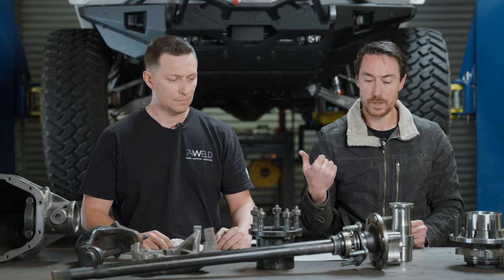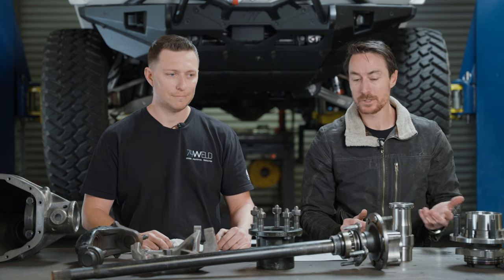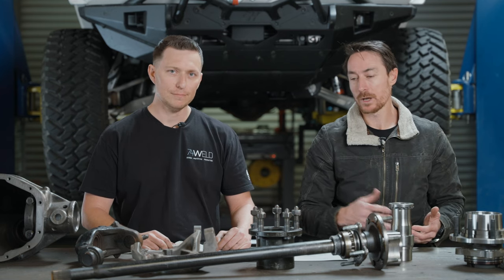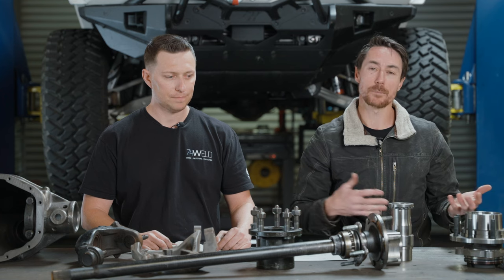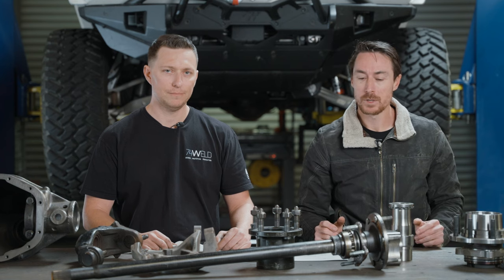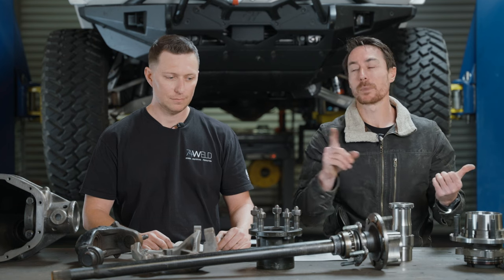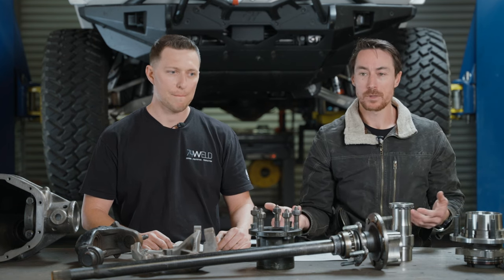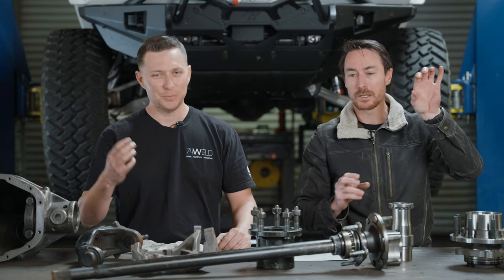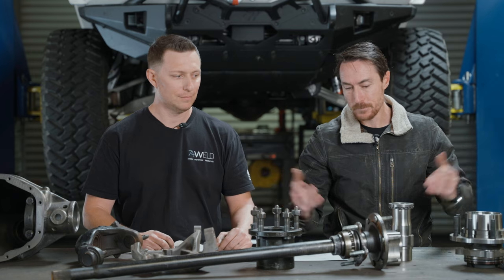On the rear, on the upper gear, every one of our upper gears is also 35 spline — that allows you to run a Dana 60 if you decide to upgrade housings, since standard shaft diameter on a Dana 60 is inch-and-a-half 35 spline. On our current kits with factory housings, you're going to get a 35-spline outer mated to a 32-spline inner on the Jeep. On Toyota it's either 30 or 31 spline inner — basically 35-spline outer necking down to 32, 31, or 30 spline on the inner.